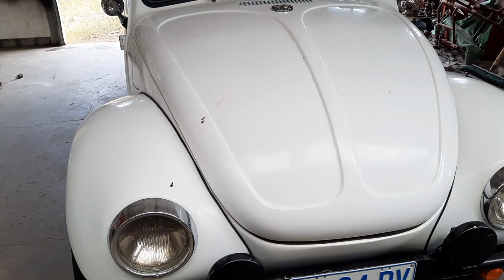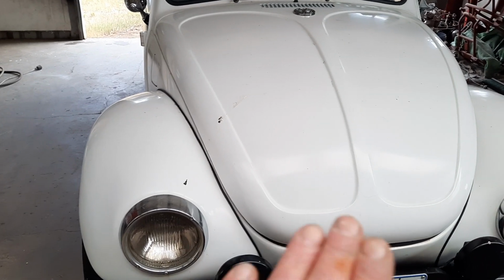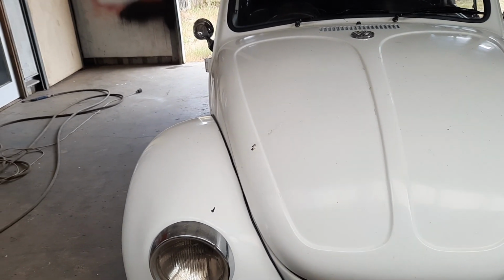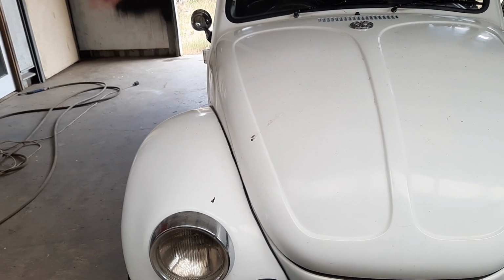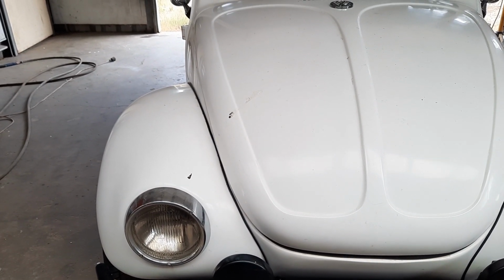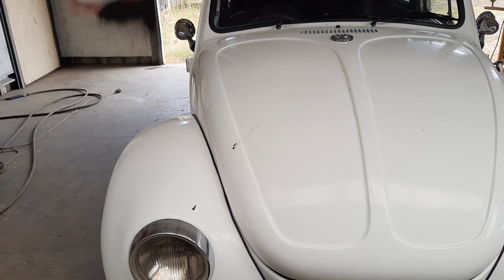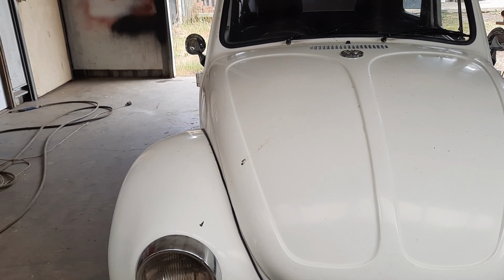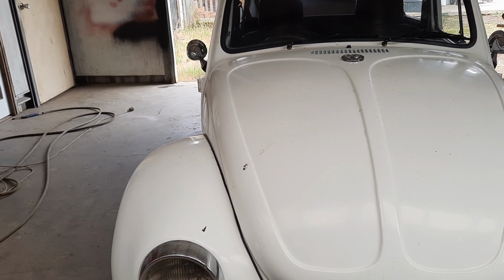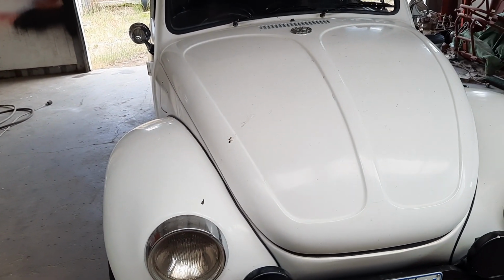What's more important is that when your wheels are straight, the pitman arm on your steering box is in the middle of its movement. Like it'll have a circular arc of movement. And so when the wheels are straight, you want that pretty much exactly in the middle of its movement. And so if you do have to adjust it, get your wheels straight, and then if you measure the pitman arm from where its travel is, it'll be off center one way or the other, and that'll tell you which side you need to adjust.